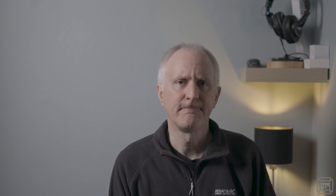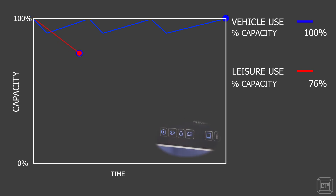Batteries are in some ways the most critical part of any caravan and most motorhomes when it comes to camping off-grid, as they provide the main method of storing any electrical power that you either bring with you or generate on-site. Batteries used for camping are generally referred to as leisure batteries. Whilst similar to car batteries, their construction is subtly different to suit the requirements of camping. Car batteries provide a large current to start the engine, depleting the battery a small amount and then being immediately recharged. A leisure battery is designed to deliver lower currents over a longer period of time, reaching a much lower level of charge before being replenished.